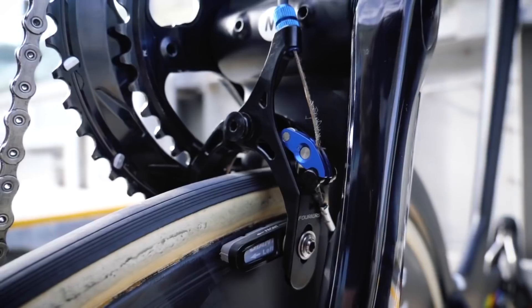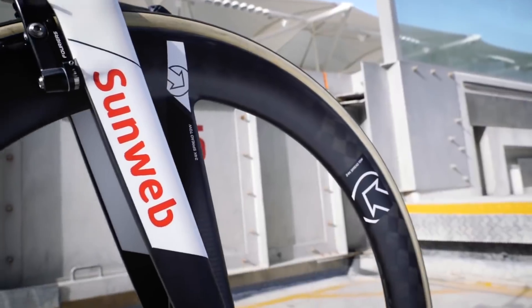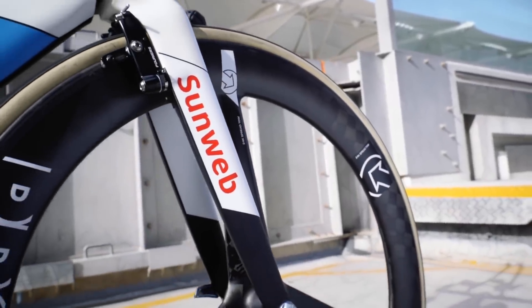Those premium tires generally have slightly softer rubber to aid grip, but that doesn't necessarily mean more punctures. You could ride a tough old tire on the same road and get a puncture, or ride a track tubular 18mm silk casing and not puncture. The tire plays a part, but so do bad road surfaces. There's no actual science I know of that says a skin wall tire is more likely to give you a puncture.